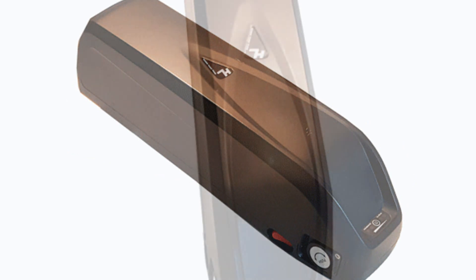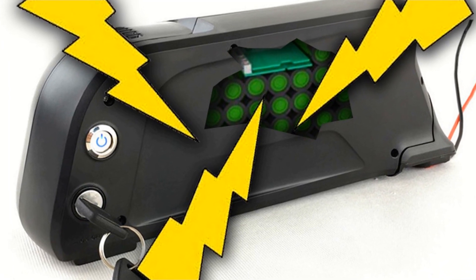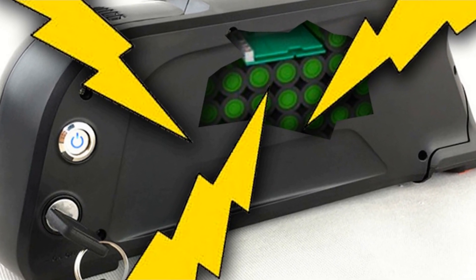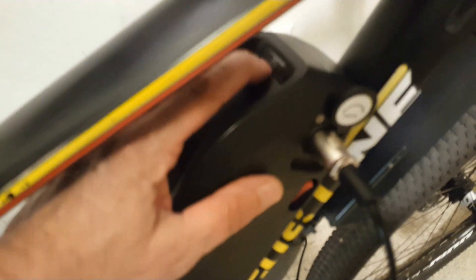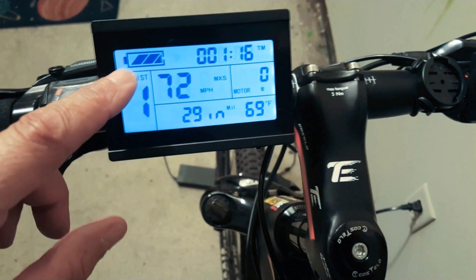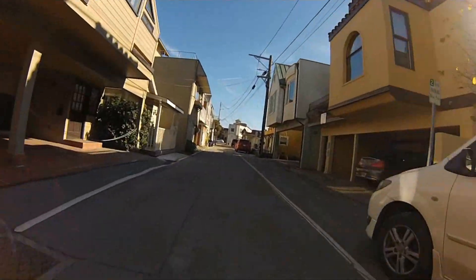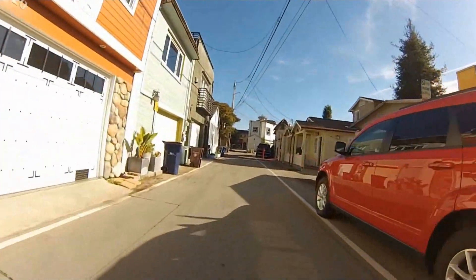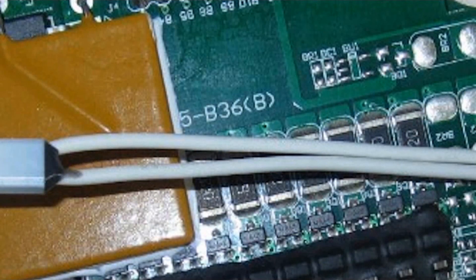Here are just a few tips for troubleshooting your e-bike's battery. Recently a customer ran into a problem with a battery he bought from someone else, which prompted me to make this video. Before troubleshooting your battery, make sure to fully charge it. The best way to check if your battery is charged is the onboard LCD on the battery itself — some controller LCD readouts aren't always the most accurate. The customer bought a 1200 watt conversion kit from us and a 52 volt battery from someone else. Everything worked great for two weeks and then nothing worked.